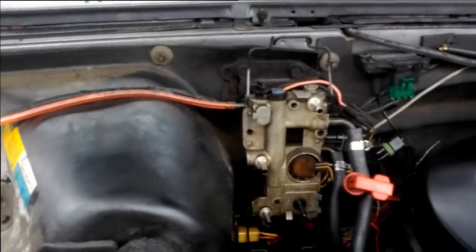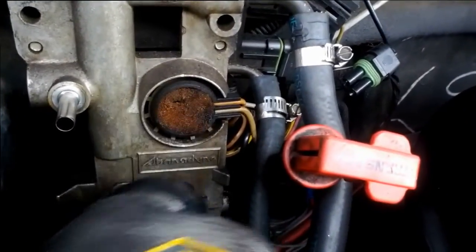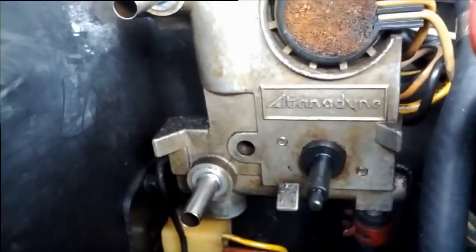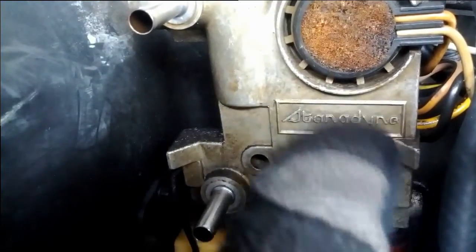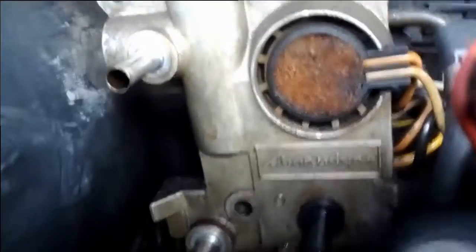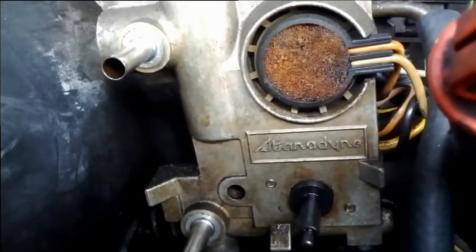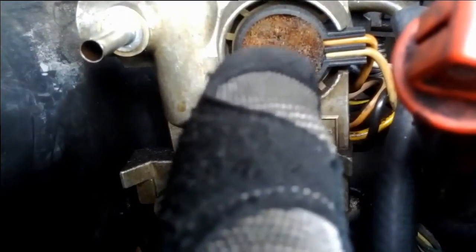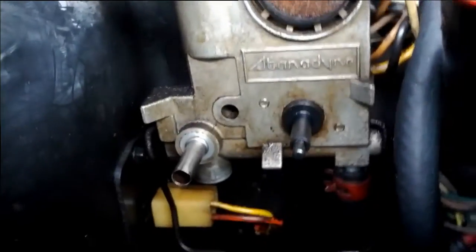Today I'm going to try and fix my fuel filter housing. I definitely think this sensor here is where the leak is coming from. You can see the foam here is all discolored — the top is cleaner looking and then down here you can see the fuel residue, or maybe it's been dripping down. It's also really gummy along the side. The plan is to take this out, put some JB Weld in that hole, and hopefully that will fix the problem.